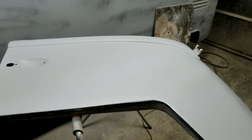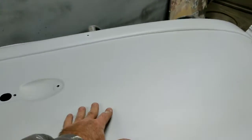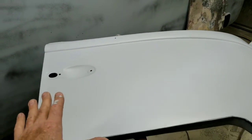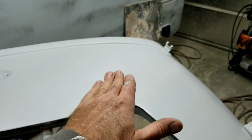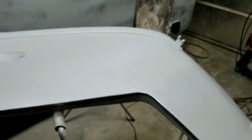And a lot of it, the whole area of the door. I'm using good quality filler, so I'm sure it's not going to crack. It does, there's some dimpling on, there's none on this. I had to get it down to where it wouldn't drum anymore. So if it pushes in and doesn't come back up, or pushes in, drums back and forth and moves, you can't put filler on that.